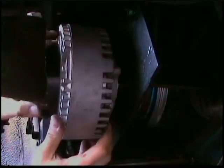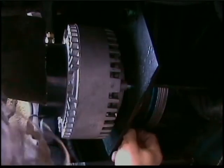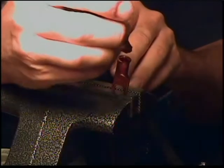Here you see the electric motor being mounted to the front end of the engine mounting bracket. Since the engine sits sideways like the original, the electric motor is near the passenger side of the vehicle. The motor is precisely centered on the bracket and the shaft of the motor is aligned with a key so that the center of the engine's crankshaft and motor are in the same place. This will later be protected from rocks, water, and other debris with the original shield that came off of this location. This is important to keep the motor in good operating condition.